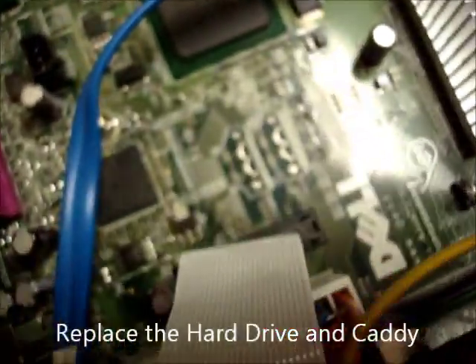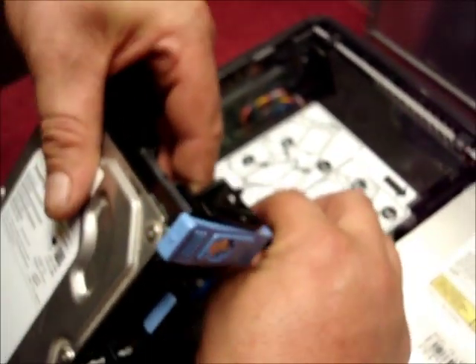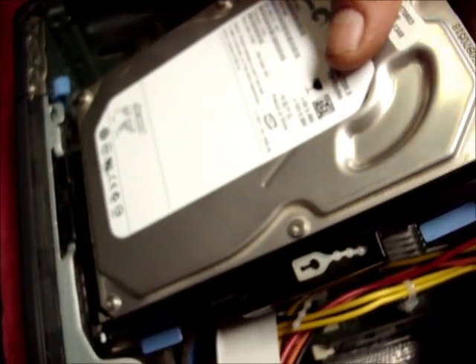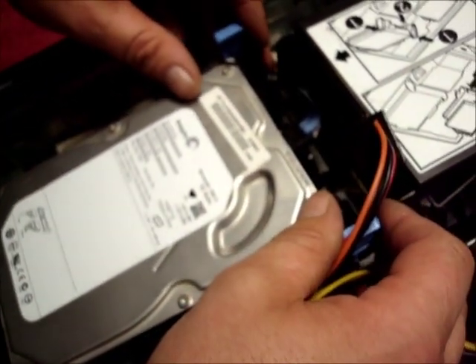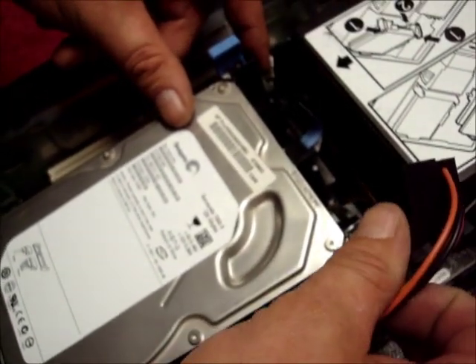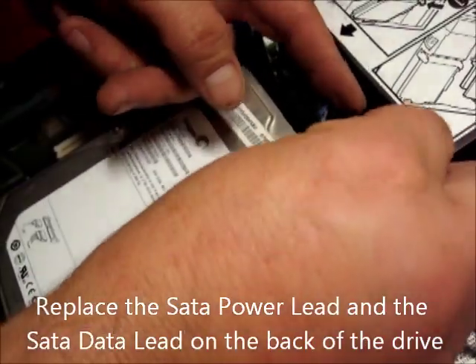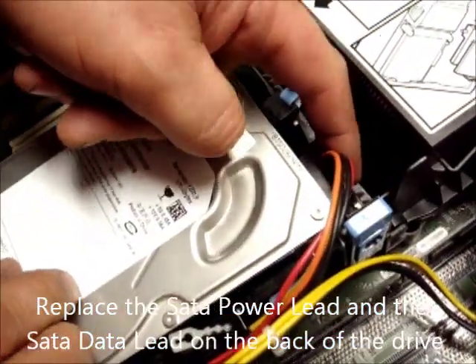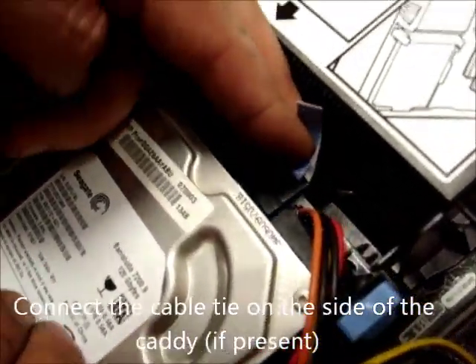Then we replace the hard drive. Hold the cables up and grab the hard drive — it slots into the back of the chassis. Then the two little locating lugs at the front near the blue clips; ensure it's in the right position and push it home until you hear it click. Replace the SATA power connector and the SATA data lead.